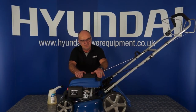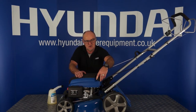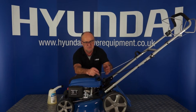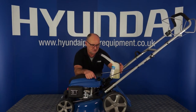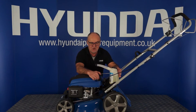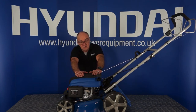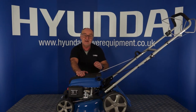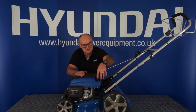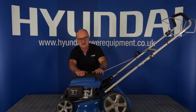The next step is to put fuel in the lawnmower. The fuel filler is here on the left-hand side of the engine — it turns anti-clockwise and will come out so far, held by a nylon brace. Fresh unleaded petrol. The fuel tank capacity is 1 litre, and 1 litre will fill it to the correct level. Don't overfill the fuel tank — your correct level needs to be well below, probably an inch below the top of the filler neck, to allow room for expansion. Never fill the lawnmower with fuel when the engine is running, and never fill it when the engine is hot — allow it time to cool down to avoid any risk of fire. Once you've filled it up, replace the filler cap, screw it on clockwise, nice and firm. Make sure that it's tight, and that's your fuel filled.